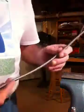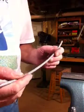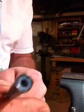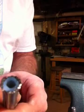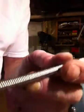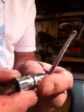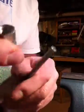Today we're going to make up some brake lines for the airplane. This is a stainless steel braided brake line — the plastic tube inside carries the brake fluid, and the stainless steel braiding is a protective cover to keep it from getting abraded or crushed. We need to install an end connector on this brake line to hook it up to the brake reservoir and other parts of the airplane.